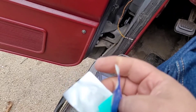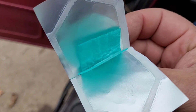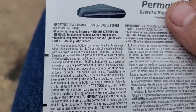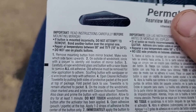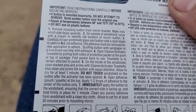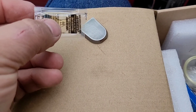I'm assuming that whatever dries on there is pretty gross. This towel is meant to stay — it starts out like that and you peel it back. Pretty nasty stuff. So we did that. Do not touch windshield or button. Open the adhesive. Apply one to two drops to the center of the button, immediately put the button on the windshield right side up, and hold firmly in place for one minute. Let it sit 30 minutes prior to mounting a mirror.